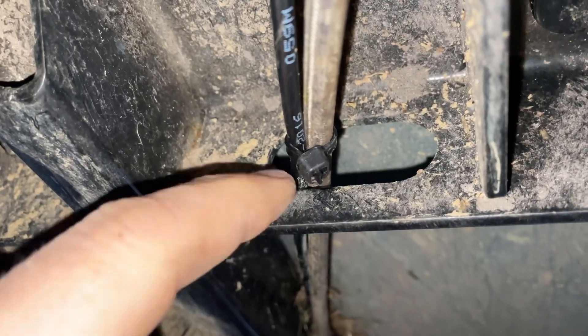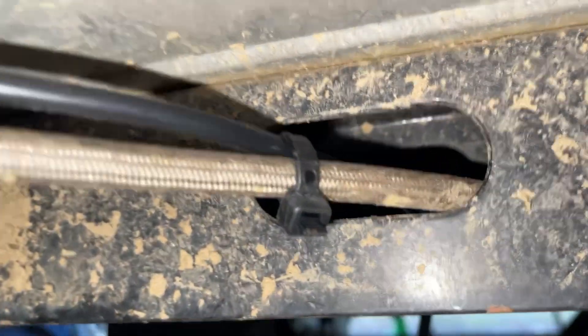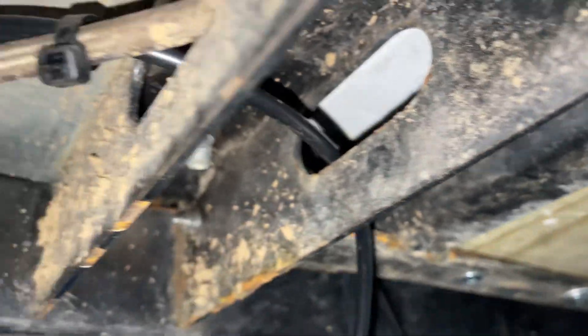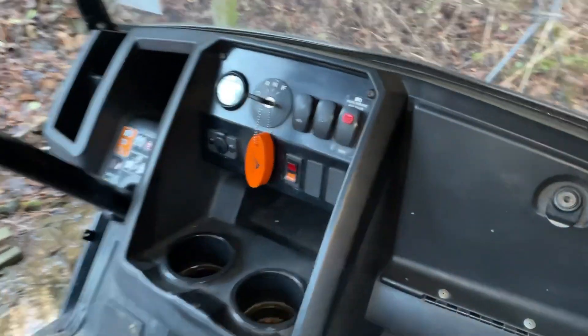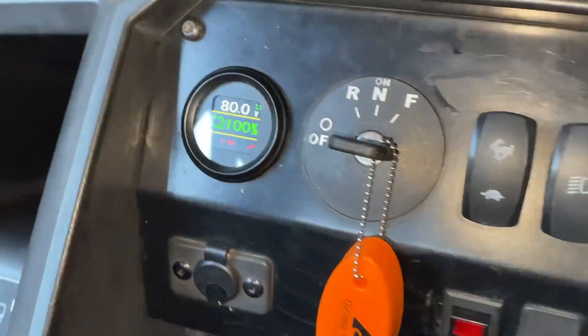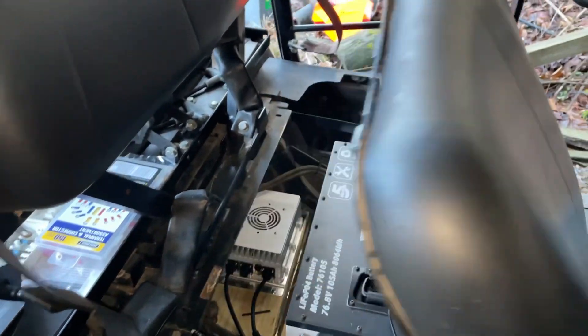You can see I'm under the buggy and there's the cord coming out of the back of the dash. I've got it running down and zip tied to the wiring harness. I didn't want to wire it to this sharp edge so I just kept it wired to the brake line, and then continued right up through there to the battery — I'll go up right through there and then pull it from up top. Got the battery in, as you can see, at the dash instrument panel there.